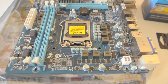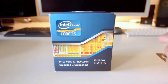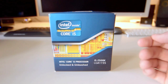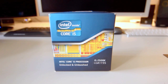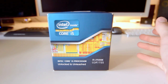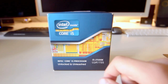Now we're going to take a look at the processor. This is the Intel LGA-1155 socket Core i5-2500K — a quad-core, unlocked processor. Being unlocked means that with a Z68 or P67 motherboard you could overclock it very easily. With a water cooler, this processor could push 5GHz depending on your cooler. I'm going to leave it at the stock 3.3GHz since it's fast enough, and it should stay cool using only the built-in air cooler.